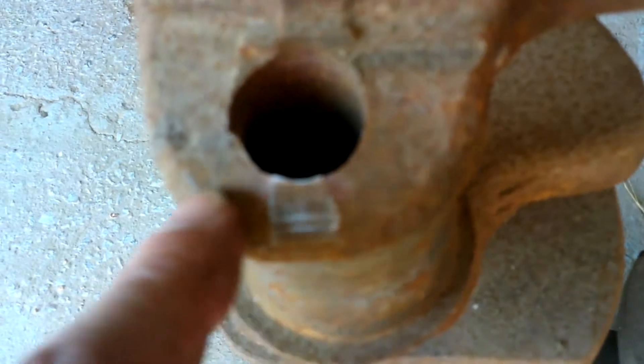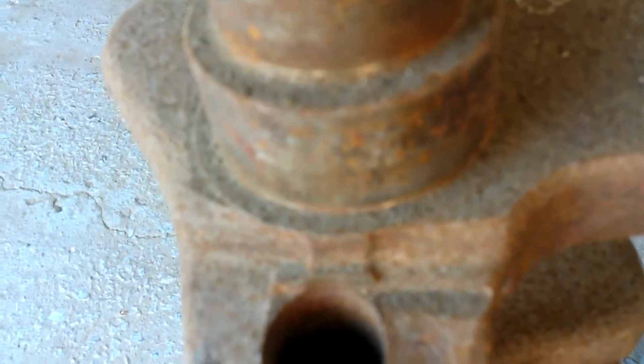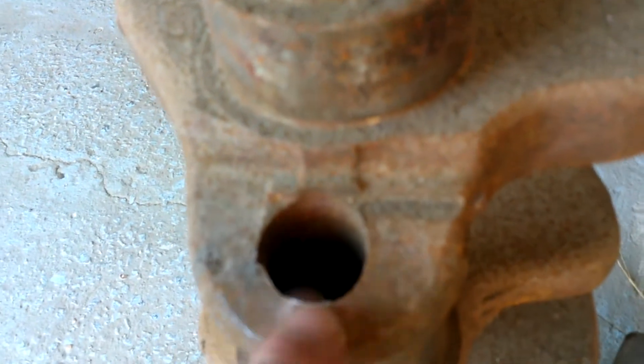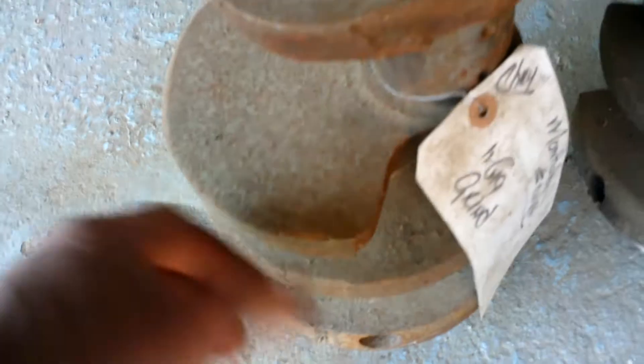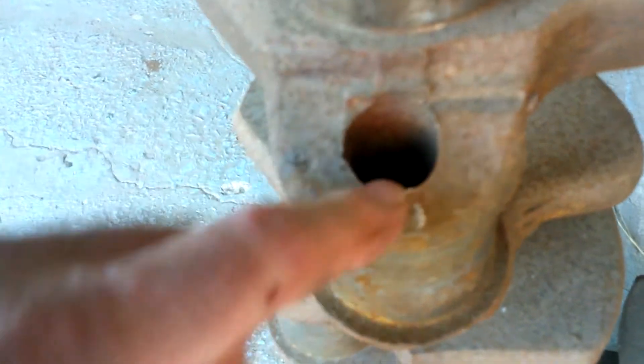It's going to have about a half-inch wide knit line. If you go up here you can see it up in here too. A lot of times it's only on this top journal because on this one the knit line's not there — the knit line is going to follow all the way down the center line. These journals are cut so they're not going to show up, but this is actually part of the original casting.